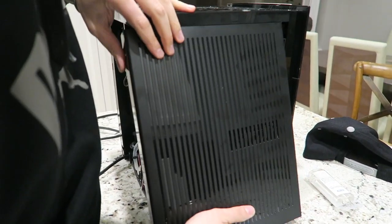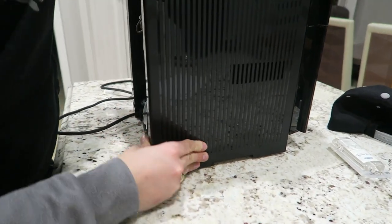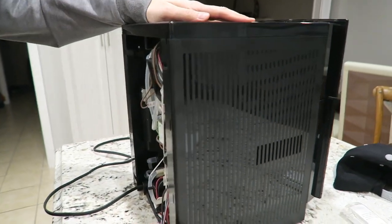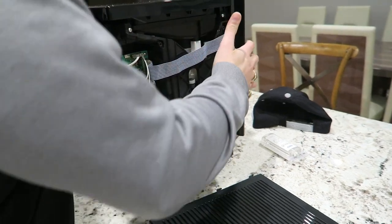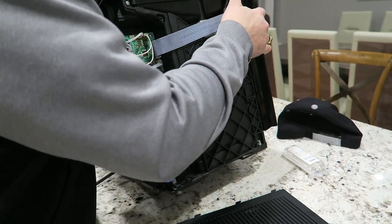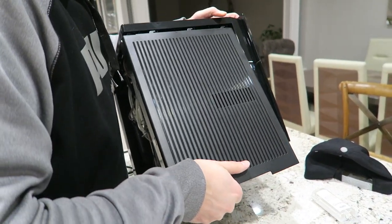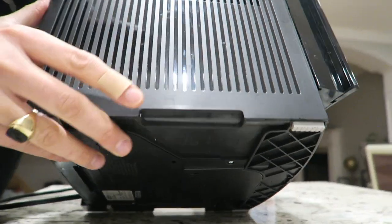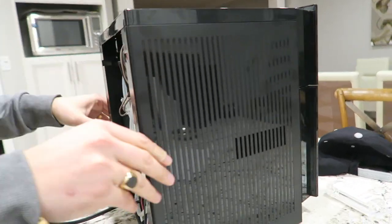Panel one done. Panel two. Get the top on, get the bottom on. Should just clip into place. Yeah. And then slide it a little bit forward. What you can do if you want, if you're not confident, is tilt it a little, but just be careful with the coffee beans, because most likely your coffee beans are not out. When you put it, you just see from the bottom if you're in its slot. And if you are, just give it a slide. And you see now, you get perfectly edged through.